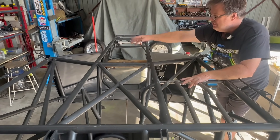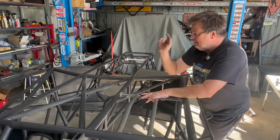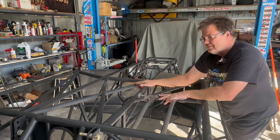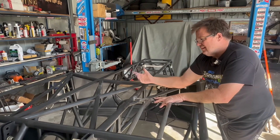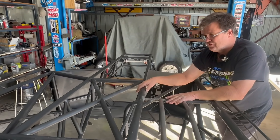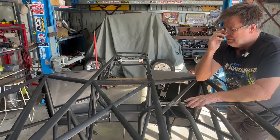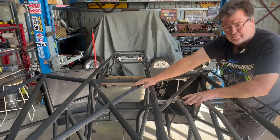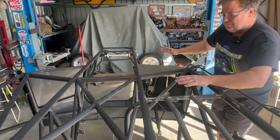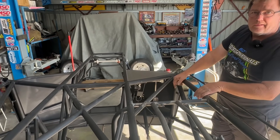The rest of the floor we're going to do in 1.2 aluminium, all with quick-release Zeus fasteners. So this belly pan here - you can get to the transmission - all these panels will just be Zeused off and taken out of the way. We could do that out of really paper-thin 0.6, but we're going to do it in 1.2 just so it doesn't stone chip and get beaten up. You've always got rocks flicking up, so we're going a little bit thicker just so they're more durable.